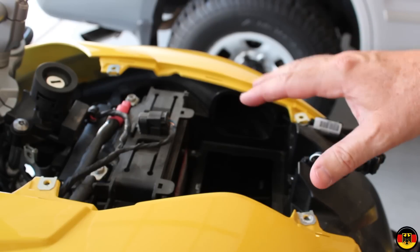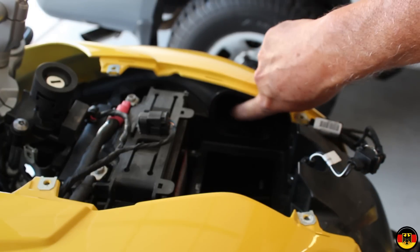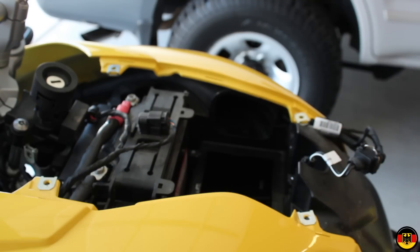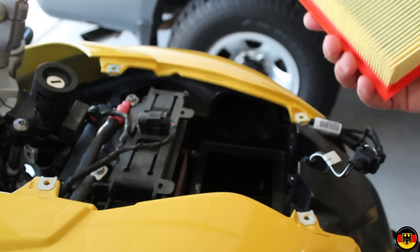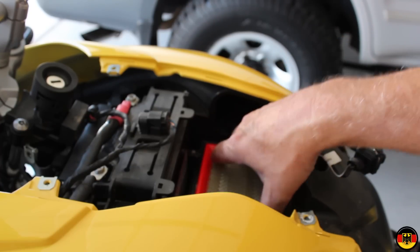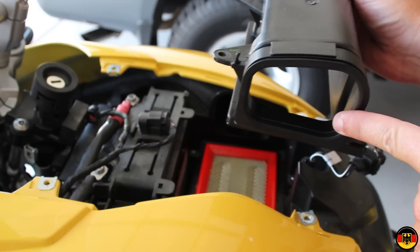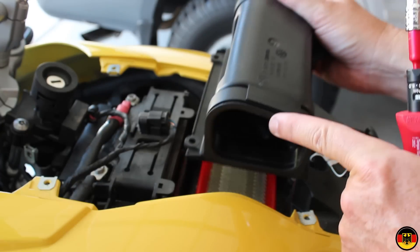Now we're ready to start putting this back together. The actual intake going into the engine is on the sides up here, and the air that comes into the intake plenum is down below the filter. I cleaned that area out and found a little bit of light muddy-looking substance down there, but the filter looks good. I can hold it up to the light and see some light through it, so it's pretty unsoiled. I also cleaned the gasket surface and put a little Armor All on it. I'm just going to put the filter in like that, then take the housing part and insert it.